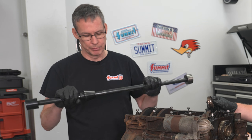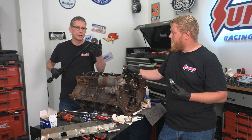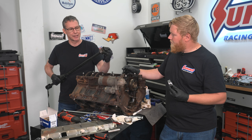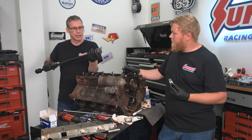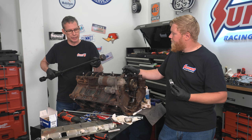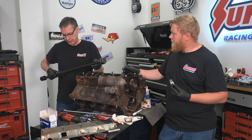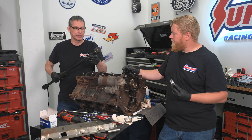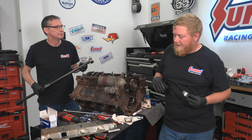Made in the USA - super awesome. It just floats in there. The mandrel is sized specifically for the cam bearing, so it just slides in like that and you clock it with the hole so it aligns with the oil hole in the saddle. The cone goes up towards the back and everything is nice and perfectly centered. So we're going to keep going with it - let's get to it.